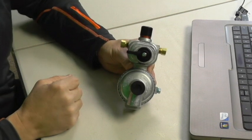What this item is, is this two-stage gas regulator that has a built-in automatic changeover. Before I explain how it works, let me tell you why it's so neat. Let's say you're sleeping in the middle of the night, it's a little cool, and you've got your furnace running. You've got two bottles on the front of your camper and one of them runs out in the middle of the night. Without this changeover feature, your furnace would go out and you'd wake up freezing cold.